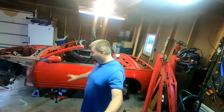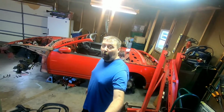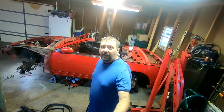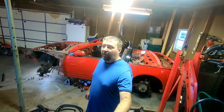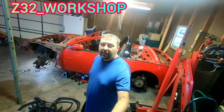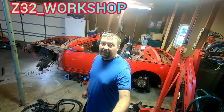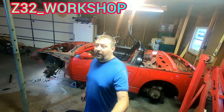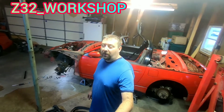So alright everyone, I know that isn't what I promised from the last video, but I thought about it a little bit last night, and that's what I'm going to be doing, is working on this front end. I think it's good information for everybody. I need to get it out of the car, and I've done tension rods before, so that was actually pretty easy for me. My suggestion is you're going to need a 17mm socket. Deep will work. 6-point is best. Also a cheater bar. A breaker bar could do it. I find just a normal ratchet with a cheater bar helps out quite a bit.